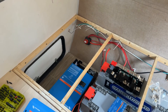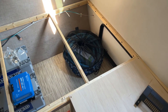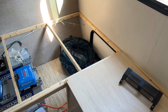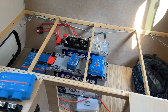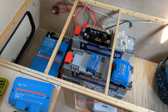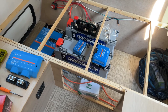I've started laying some things out as an initial design, and we're trying not to lose a lot of storage space. We've got one access door externally over here. We're going to put the inverter over on this side - this is basically like a pass-through storage. We've got another access door over here with more storage underneath this panel. We're basically trying to allow the user to ventilate this compartment where the batteries and inverter are, because the inverter does get pretty hot when it's charging and inverting. It has its own fan, but it's not ideal that it's laying on its back - it's better to have them mounted upright vertically on a wall. In the case of this little RV, we don't have that opportunity, so we're making do with what we can. This allows the user to open both compartment doors to get some cross ventilation.